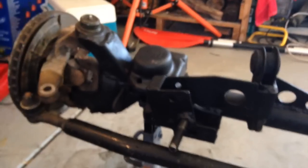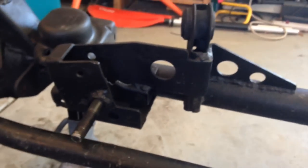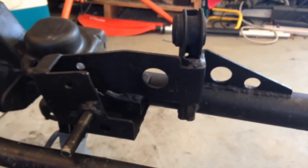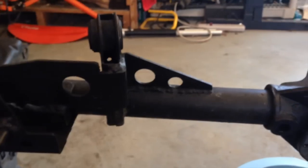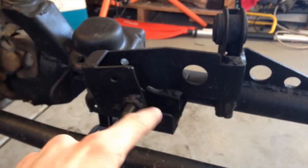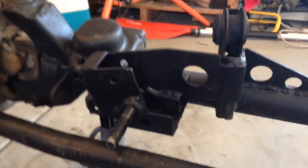Once you have the gussets and a track bar bracket sorted, you can get one that bolts on to the actual housing or one that welds on. Personally I prefer weld-on — I don't like using bolts on things I don't need bolts for. There are tons of companies that make them. If you get a raised track bar bracket especially, make sure it doesn't just use the stock mount and that it somehow reinforces it, because raising it puts even more stress on the stock bracket.